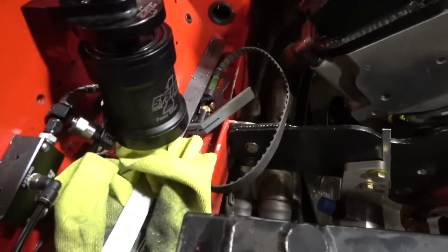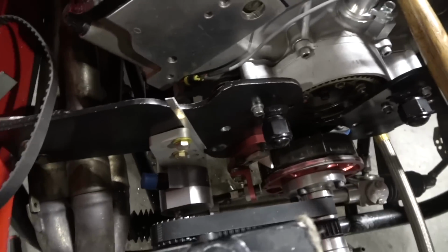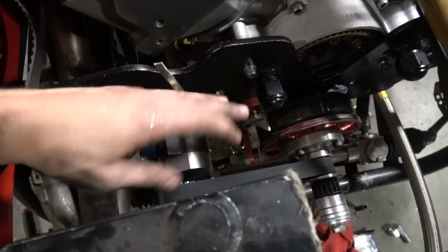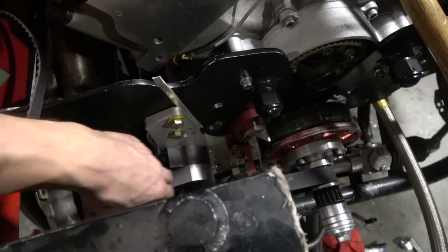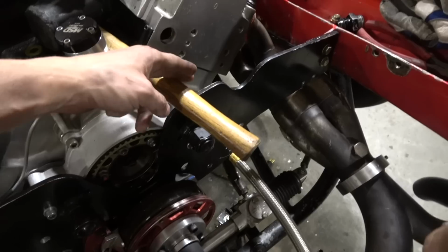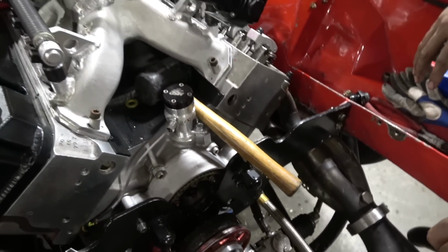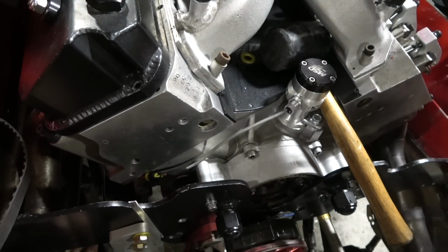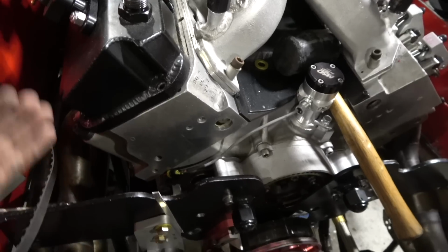So we got this. It's going to come out. The oil system is going to come out of the pump right here. Clear view is going to be mounted right here. So it's going to come out of the clear view, go in the clear view, come out of the clear view, go across the top of the motor, down into the inlet fitting of the block if we ever get one in it. Fuel pump feed out of the bottom, 90 into the bottom of the pump, bam, done.